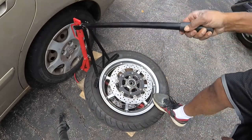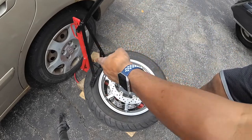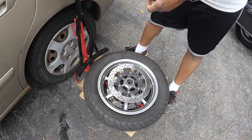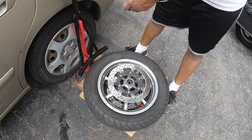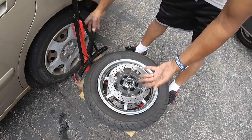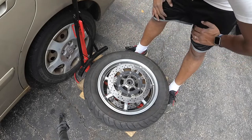And that's it. As you saw, in the video I'll put before this that I recorded with my phone, I support the back end over here with the car itself. That way, the rear end of this thing isn't lifting up on you. And that's basically how I use it — that's basically how I support this Harbor Freight bead breaker so I can break the beads on my motorcycle tires, my car tires, whatever I need to break. And it worked great. Thanks for watching.